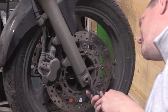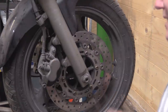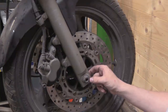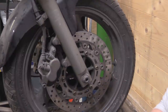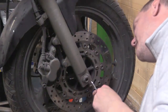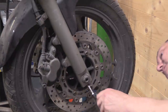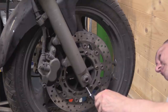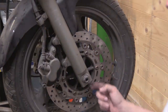So what we can do, in a sense, is just grab this with the calipers, like this, and find out that that's 28 millimetres. It's 28.1 something, right? Which means that if we go 28, let's go 14. Get 14 on these, and then just put that either, it's a shame you can't butt that against there, but now I can see that it's pretty much bang on the centre. Right, wonderful. So what I need to do then, I can use this surface, I can use this back surface, or anything.